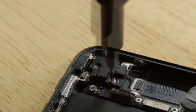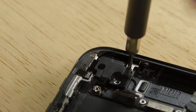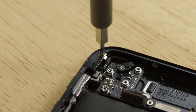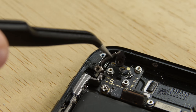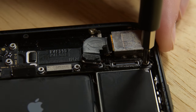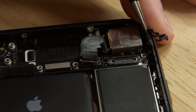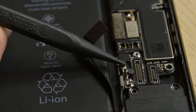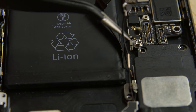Lift away the upper cable bracket and use the flat end of a spudger to disconnect the upper cable connector. Remove the four Phillips screws securing the antenna and remove the top left antenna. Then take out two more Phillips screws to remove the bracket. Grab your standoff bit and remove the standoff screw from the grounding bracket. Use tweezers to gently bend the logic board grounding bracket out of the way.